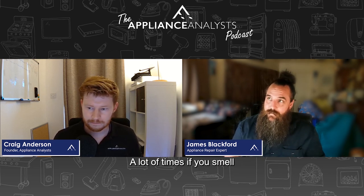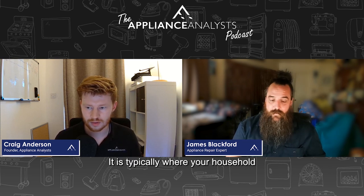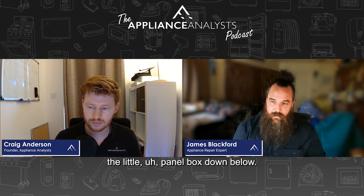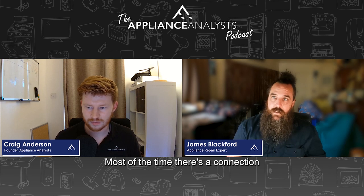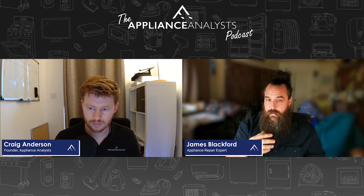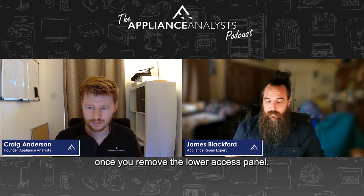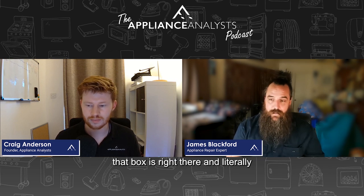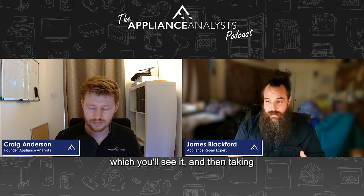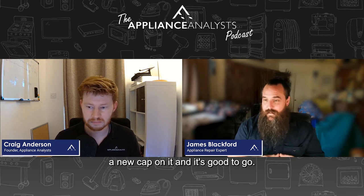And then smells too. A lot of times if you smell a burning smell, like a chemical plastic burning kind of smell, it is typically where your household power hooks to your dishwasher in the little panel box down below. Most of the time there's a connection that's worn out and it'll just short out. And if you're comfortable with electricity just a little bit, it's very simple. Once your breaker's turned off and you remove the lower access panel, that box is right there. And literally the fix is finding which wire's burnt, which you'll see, and then taking the old cap off, cleaning up the wire, and putting a new cap on it, and it's good to go.